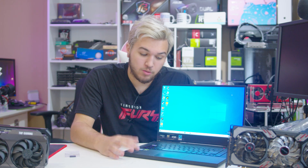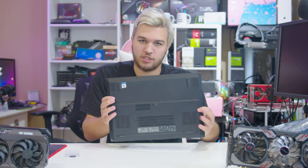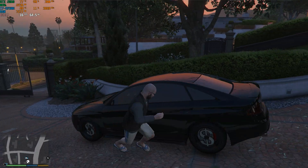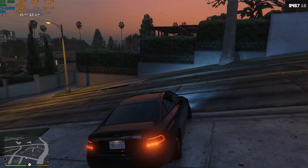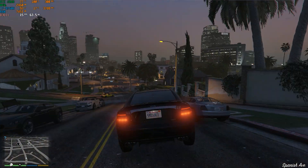Before filming this video, I did some performance testing on the laptop in its current state, which is dirty, dusty, and not that great. I was going to do multiple games for a before and after, but GTA V proved to be too much for it — both our CPU and GPU instantly shot up to 100 degrees even under maximum fan speed using a program, and it thermal throttled to the point of unplayability. That simply will not do.